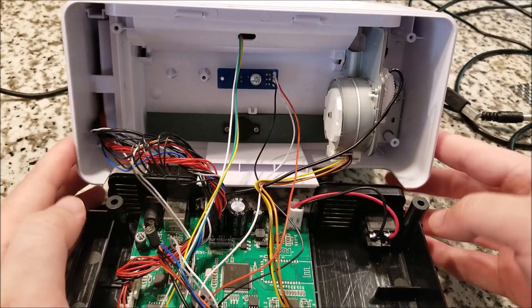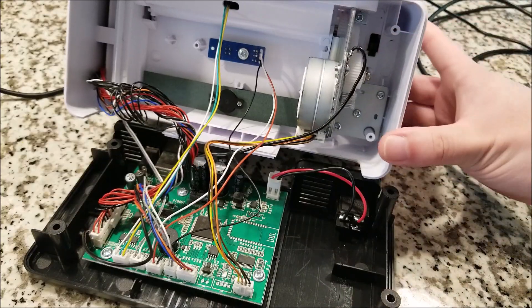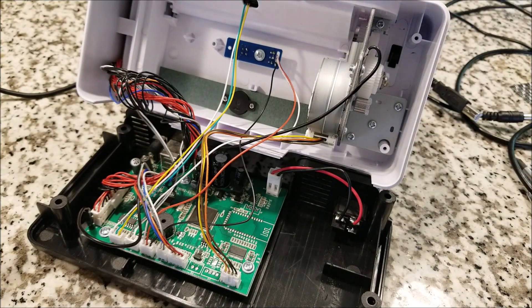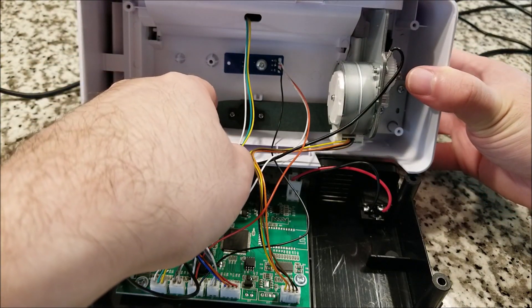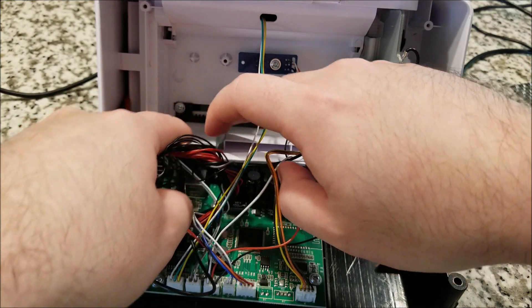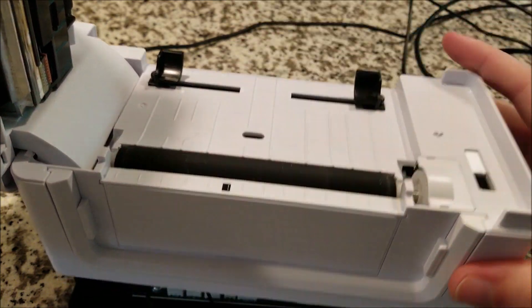We have gears along the sides — the stepper motor is a pretty sizeable unit, so it should have good torque, but they also geared it up with two additional sets of gears of increasing diameter. This makes it very beefy and able to pull from an accordion setup with no problems. There also appears to be something in the back: two screws reveal a rack-and-pinion mechanism — when you move one paper guide, the other moves too, so it's always centered. That's quite clever.